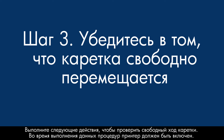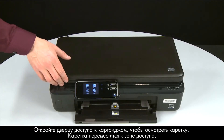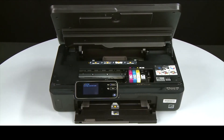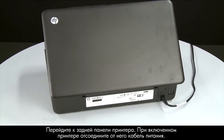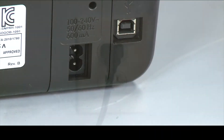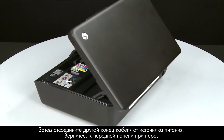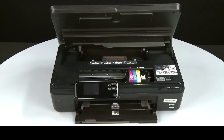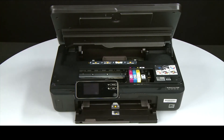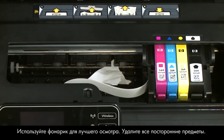Use the following steps to make sure the carriage can move freely. The printer must still be on for these steps to work. Open the cartridge access door so that you can view the carriage — it will move into the access area. Turn to the back of the printer. While the printer is still on, disconnect the power cord from the printer, then disconnect the other end from its power source. Return to the front. Look inside the printer and check for obstructions around the carriage using a flashlight for proper viewing. Remove any obstructions that are found.